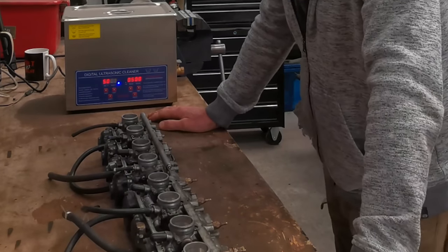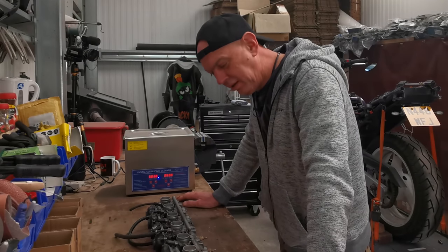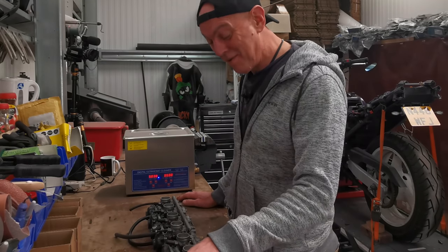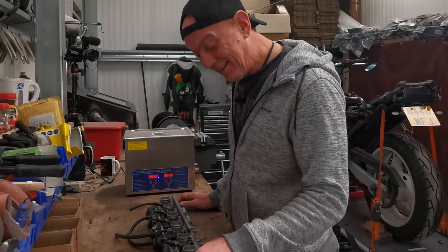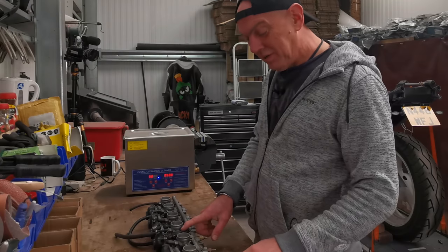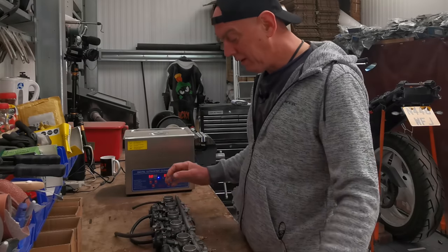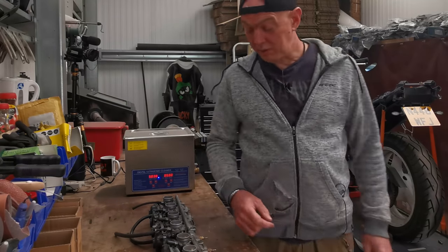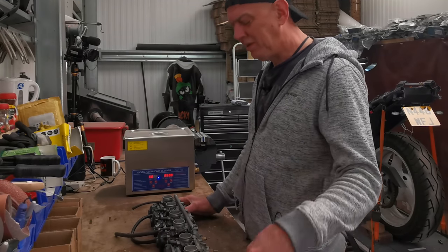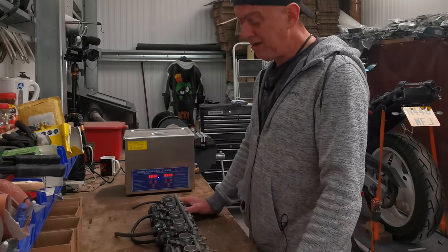So it got me thinking, and I thought, right, who's going to know? Matt, he knows everything. We had a really good natter, actually. It's the first time I've physically spoken to the guy. He is diamond. As far as the throttle position sensor goes, it shouldn't really matter. It's not plugged into anything, and some goon has just cut the leads off anyway. I don't think there's anything to plug it into on that one. Essentially, that's all just to do with advancing or retarding ignition. It's an ECU thing. If it ain't plugged into anything, nothing's going to happen anyway.